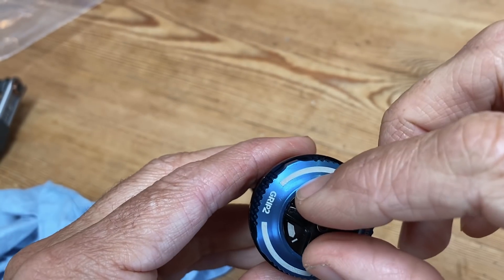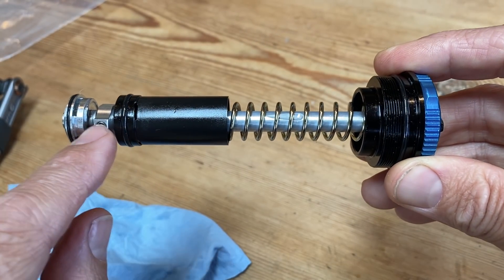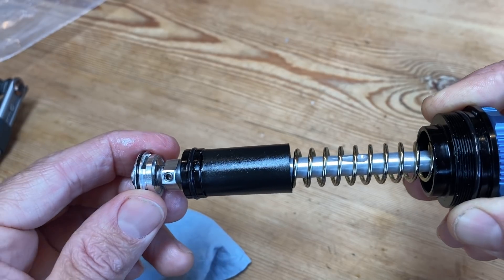For the first time ever, VVC is also being used on the compression side. It's a little harder to see here. Low-speed compression — the one in the middle — just turns a rod down the middle that works through a small hole. High-speed compression uses this little wing, which is your VVC. All it's doing is changing the fulcrum point of that wing so that it feels like there are more valves and firmer compression damping.